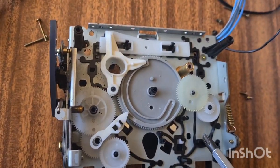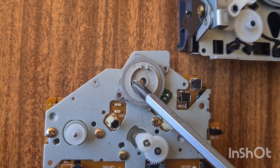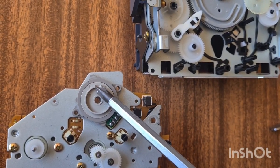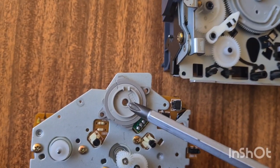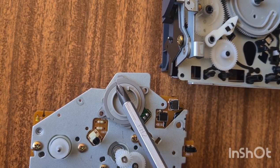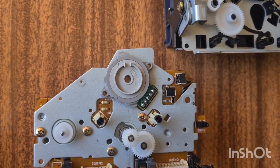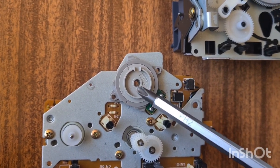This wheel is going to sit about here, and you're going to pop the belt over the top of it. The issue with this one is this switch here — it's a rotational switch, and this little groove sits over the top of this. When you're rebuilding it, it's important that you get this inside this groove here. The manual states that the simplest way is to line up this arrow with this line on the edge. Inside there is a really simple circuit board with five contacts — it's a rotational switch, much like a volume switch. This was just all furred up inside and full of crap and crud.